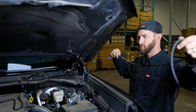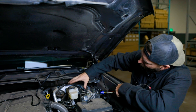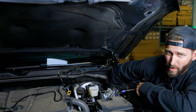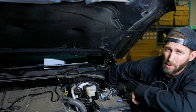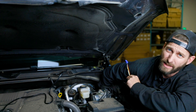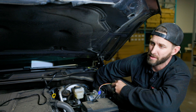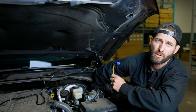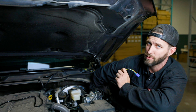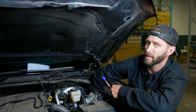The last thing we have is the lead for our switch. This needs to go into the cab on the driver's side where all your OEM switch blanks are. You've got your master cylinder and brake booster here, and your ABS. Down back here against the firewall is a rubber boot with a little cable going through it — this is where you can push the wire through into the cab. Some people like to cut a hole in this and push the wire through the rubber boot; others prefer to push it out of the way and go through the top. There are advantages and disadvantages to both. Wiring is definitely one of those things that needs to be done by an experienced professional, so do what you think is best. I'm going to go ahead and get this routed into the cab so we can plug in our switch and do a wiring check before we tidy up all these wires.